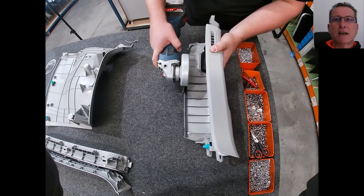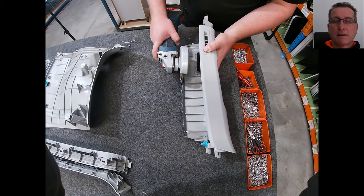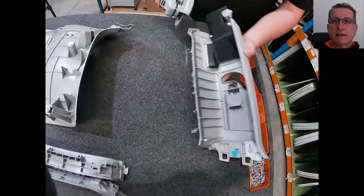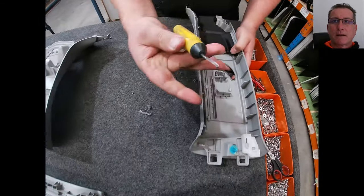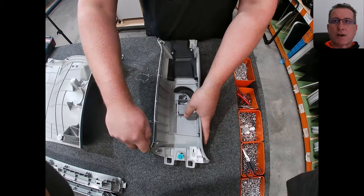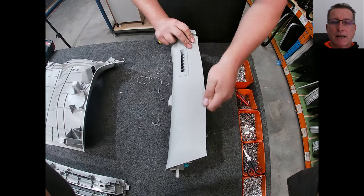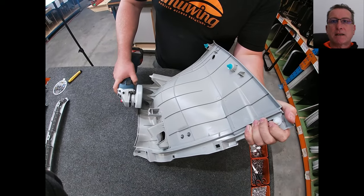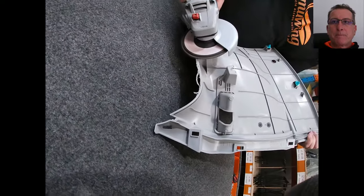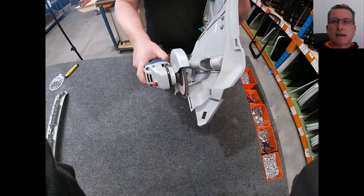It's only a few mil that needs to come off. As you can see on this trim, we're actually only going back to the foam — that piece of foam on the inside is all we're trimming off. Again, clean it up with a deburring tool just to make sure that cut's nice and straight. We can finish with a file, but we actually got this quite good with the grinder — again just using a flap wheel. There's not enough material to take off to make it worth trying with an actual cutting disc. Just be very careful because a very aggressive flap wheel can easily damage the panel — we can easily go too far.